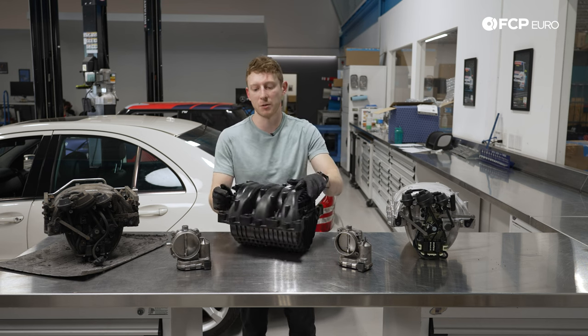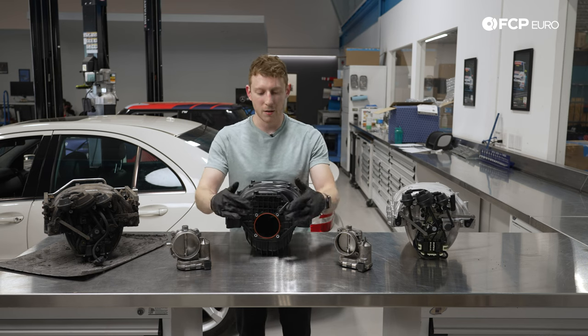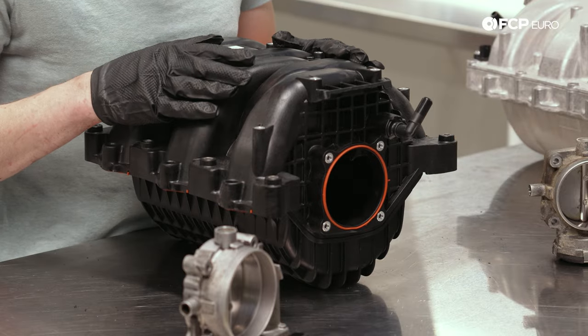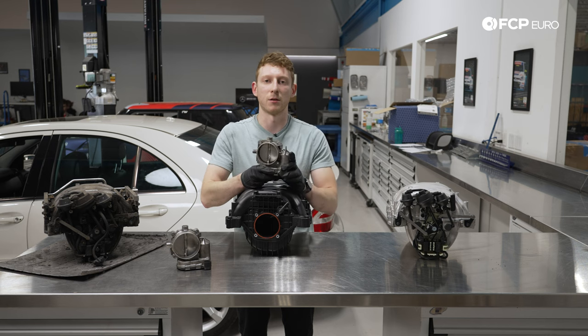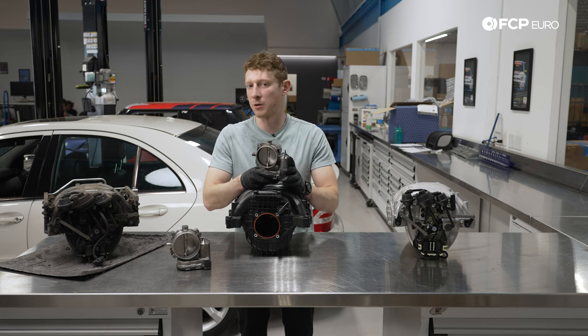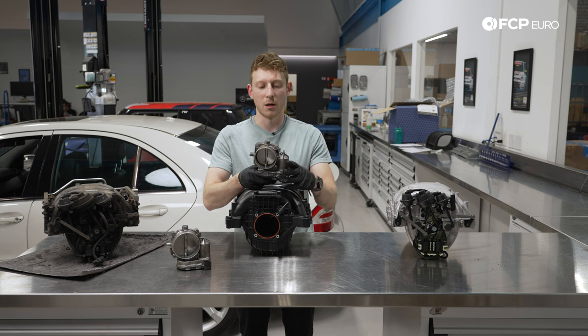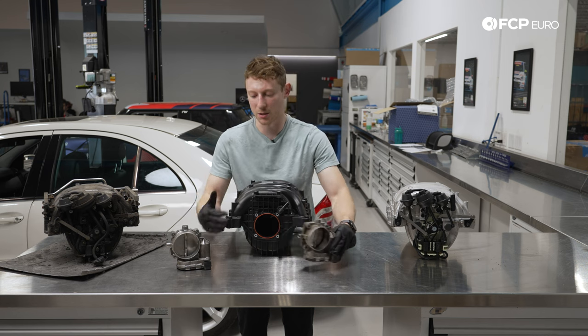Additionally, these being factory equipment on the M014 sport package SLK, this inlet right here for the throttle body is actually larger than it ever was on any other M272. So this right here is a standard M272 throttle body — it's the very same as the one on the M112 or the M113 — it's 74 millimeters. That will bolt directly onto this one. However, it will not bolt onto the M014 manifold because this is upsized.